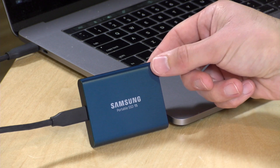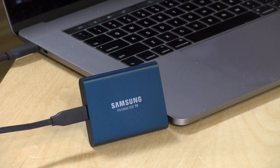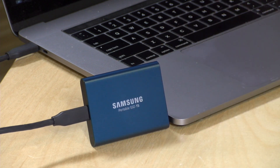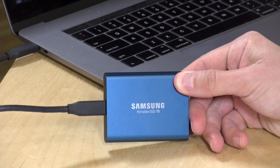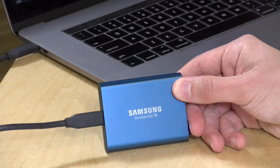This drive performs about where I would expect. The sequential reads were probably its biggest selling point, but it is a little slower on the writes versus the prior T3. Random reads and writes showed pretty much identical performance to the prior edition. So if you can find the T3 at a good price, grab it — you're not going to see any real huge performance gains on this unless sequential reading is really important to your workflow. But overall, this is another great drive from Samsung, something I can recommend. It will remain in my bag for my field activities, and it seems to be working as well as their older technology.